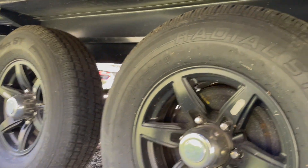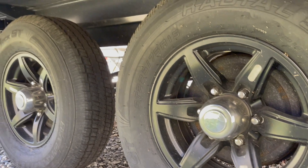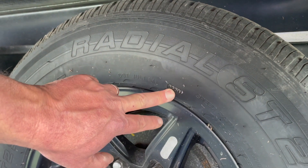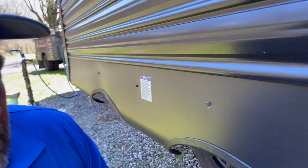Unfortunately, in the times that we live, they only make these tires to last so long. You can find on the tires a DOT date — this tire here was made the third week of 2020. When tires get up around four, maybe five years old at the most, it's time to change them because they just don't make them to last long. If you're starting to see dry rotting or cracking in the sidewalls, just do yourself a favor and go ahead and replace the tire. You don't want to be on the side of an interstate because you gambled with dry rot.